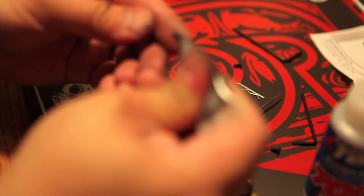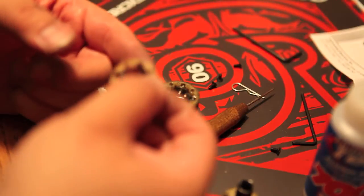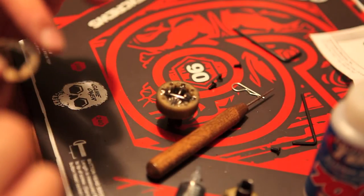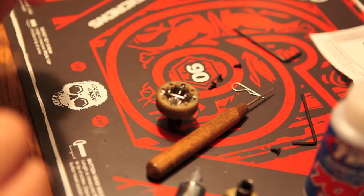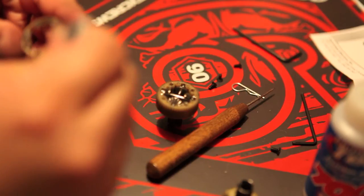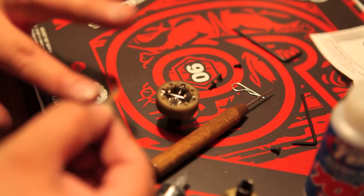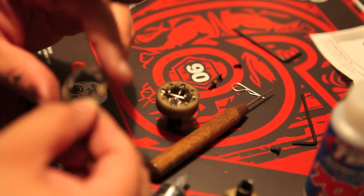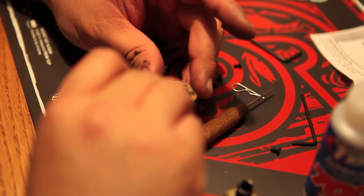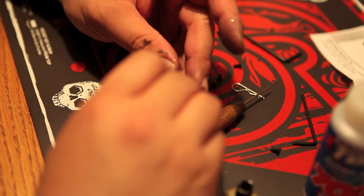I'm applying black grease to both sides of this cardboard seal so that it stays in place. I don't want the differential fluid leaking out from the gear differential. The black grease acts as a sort of sealant — that's my little trick for keeping the differential fluid in there. I'm lining it up and doing my best not to mix the black grease with the differential fluid.